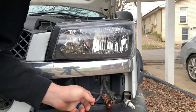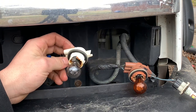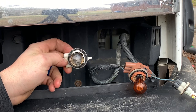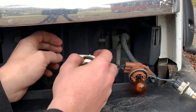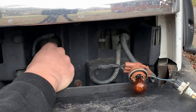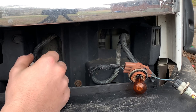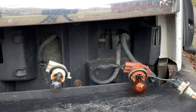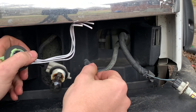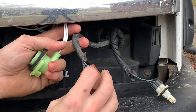Here's your wiring. Now this plug is a little screwed so either way I'll probably end up having to replace this. I really don't want to start just hacking up this harness and leaving all this exposed. What I'm going to do with this one is just kind of tuck it back here, maybe tape it off so nothing gets in there. What we're going to do with these is just cut this tape back a little bit and then just tap into these three wires.